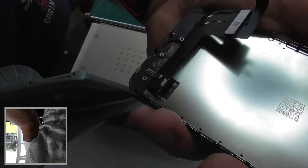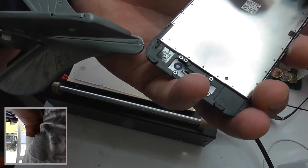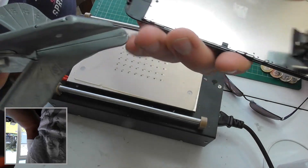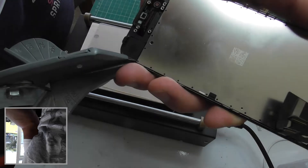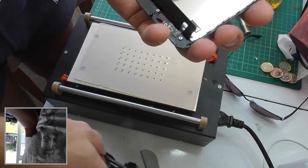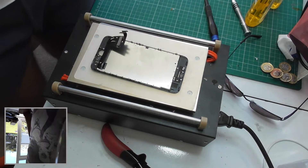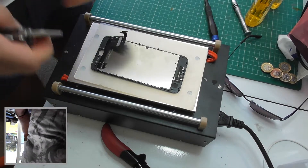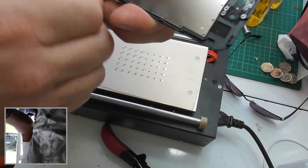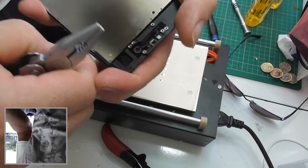What I'm trying to do is just cut these corners with a pair of anvil shears — I think they're called that. You can do that on all four corners so that you can remove the frame, or just enough frame to get your wire in there to remove the glass. That's done. Put it back on the heat plate. Sometimes these come off fairly easy, sometimes they are a nightmare. I just take the pliers on some of the metal end and this one is fairly tough but it's coming away — quite easy actually as far as iPhone 7s go.